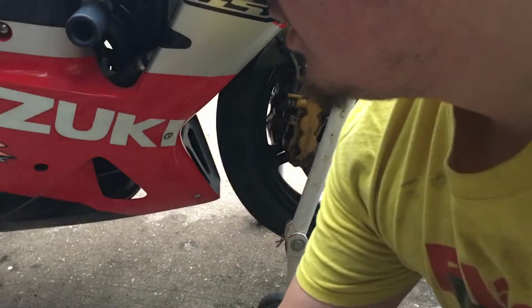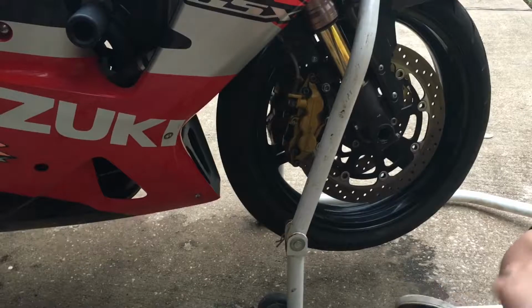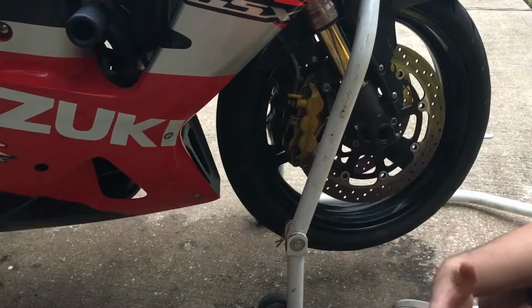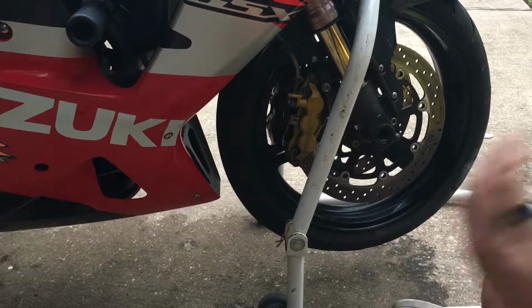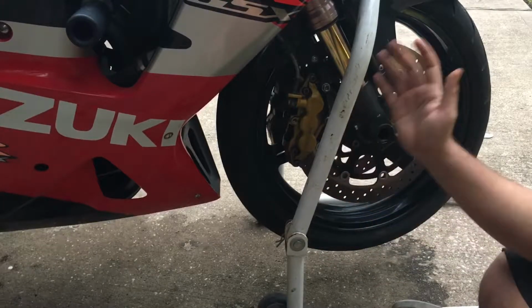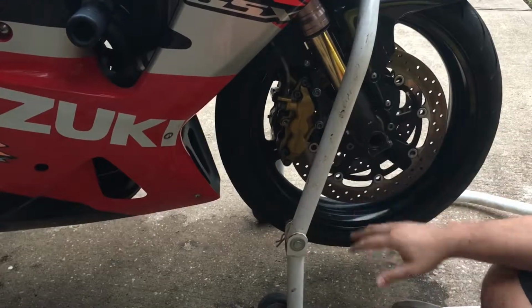That's not good. So that prevents it from braking, and since the brake pad's actually not grabbing to the rotor, it causes it to slip and eventually overheats and your whole brake system is toast, then you'll have to replace it. So taking precaution on here, and I'm gonna go ahead and clean the caliper and then the rotor.